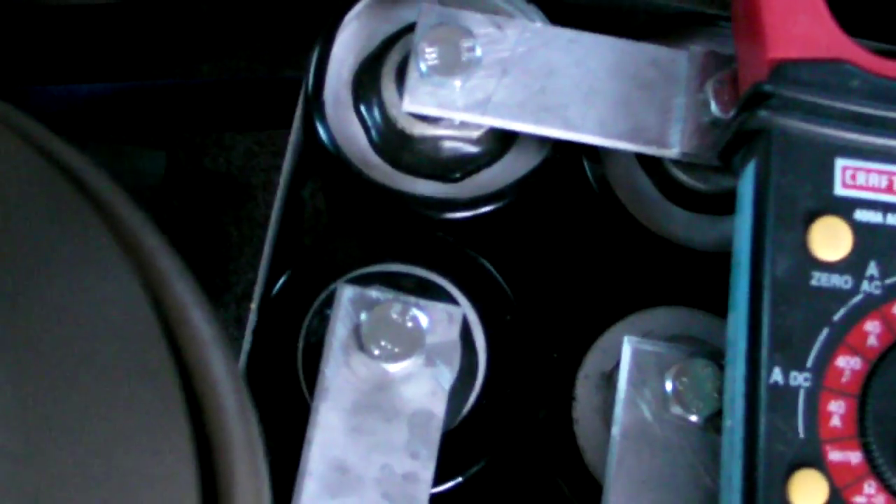Right now you can see the negative lead is not hooked up, so the caps aren't doing any good. We're going to start with starting the vehicle. Watch my voltage — granted my battery is pretty dead up front, but you can see the kind of drop you might get. It dipped to like nine-ish, mid nines, high nines. It kind of rrr, rrr'd and then started, which I just don't like the sound of.